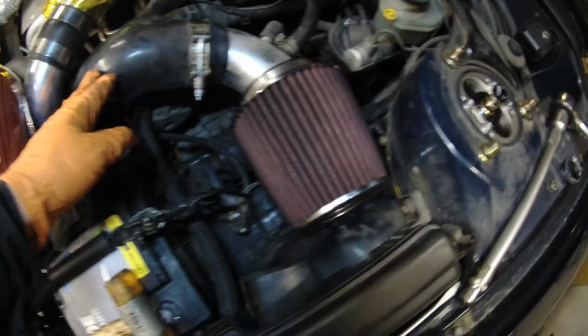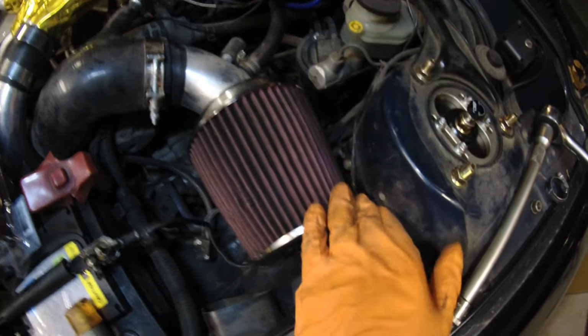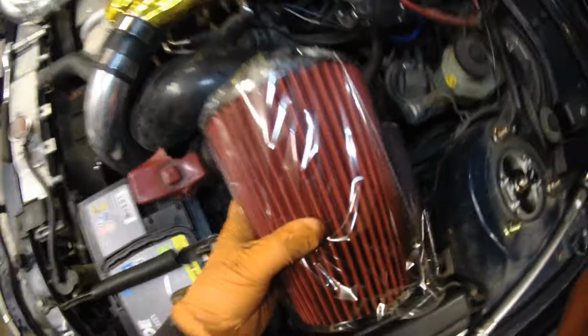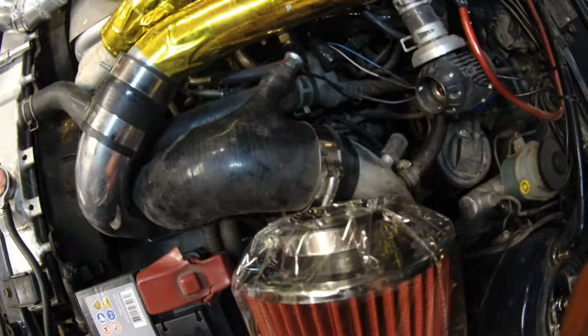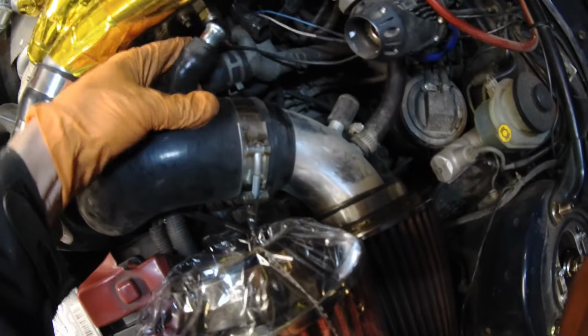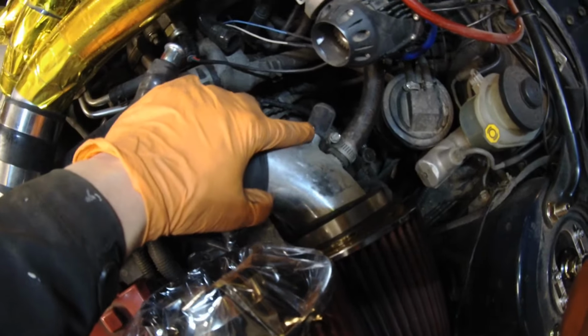Currently the air filter is located very much to this side here, but I want to put a bigger one, and I think it makes sense to pull it out a bit and put it more over here. First of all, it will have more room for its length, and also it will make this pipe shorter. Probably I'll have to cut it already from here, so I'll lose this thing here. However, I have a spare port here as well.